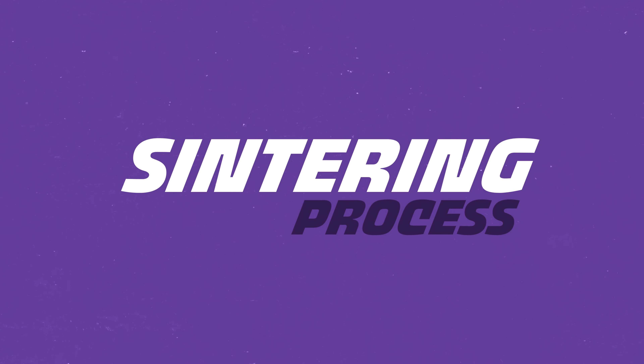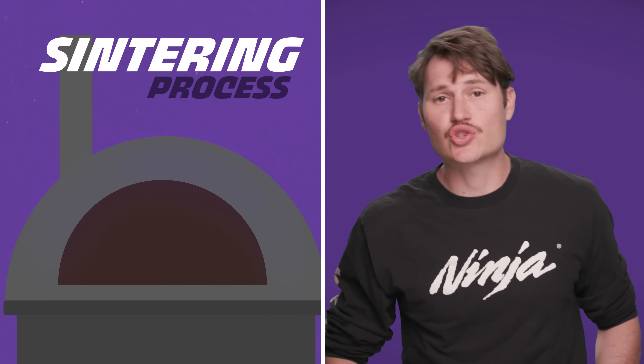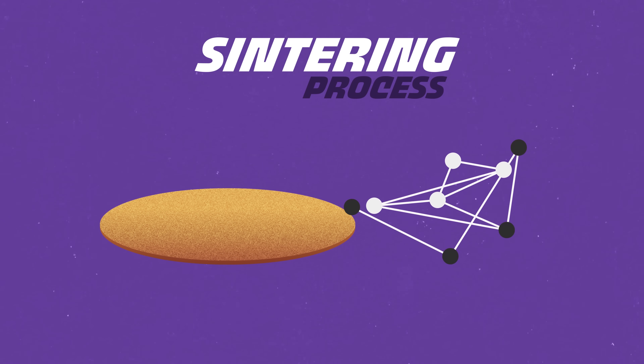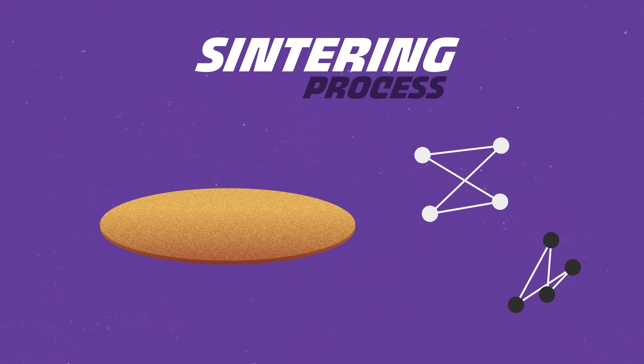Sintering is a process of putting parts made of compressed iron powder through a very toasty furnace and adding high pressure. The goal is to control the temperature so it reaches just below the melting point of iron without actually liquefying. The heat and pressure works at a molecular level, causing the metal particles to bond together so you get a stronger disc with enhanced properties from the original metal. It diffuses other elements like carbon that may be in the mix and reduces pore size, increasing the strength of the bonds between the particles. Because the discs are so dense from being heated and compacted during the sintering process, they can absorb and dissipate a lot of heat energy before their temperature goes up.